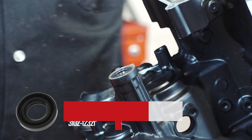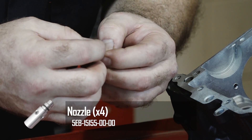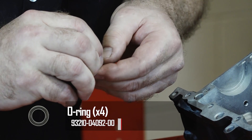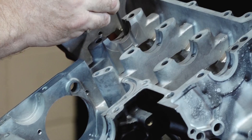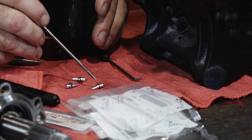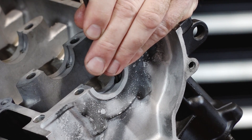The next part is a little bit tedious. When we sent it off to get this thing bored and plated, they also removed these little nozzles that actually spray up into the piston walls, so we need to get those replaced. Each one of these nozzles has a little O-ring that goes on it, into this smaller groove — be careful not to rip this little O-ring, it's pretty fragile. Let's get a little bit of oil in each one of these passageways and put on the O-rings themselves. Let's go ahead and push them into place using a small punch tool — tap them in very gently, and just make sure you've got them lined up perfectly when you knock them in.